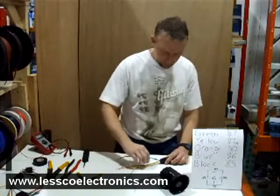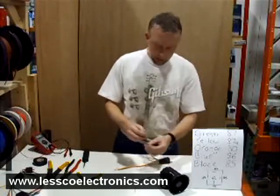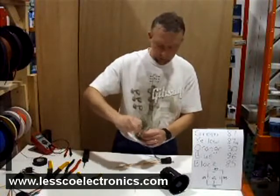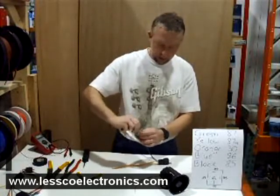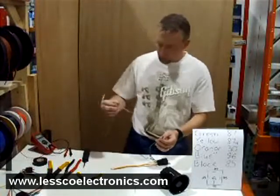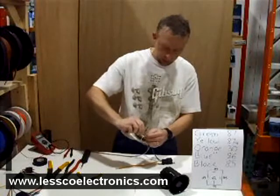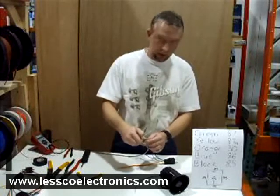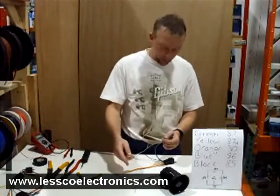So the way you do it is this: you're going to grab one of these relays and wire it up just like this. You're going to take the green and the black — I'm not going to tell you the pin numbers because I have this cheat sheet right here for you guys to follow along with. You can always pause or rewind if I go too fast. The black and the green are going to go to 12 volts. The black is one half of the coil which clicks the relay to do the action, and the green is the supply power — whatever I put on this wire is what's going to come on the output of the relay.